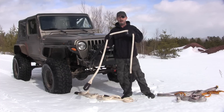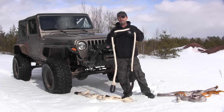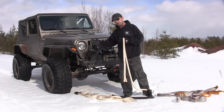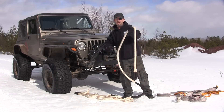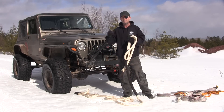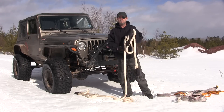This is a one-inch rope. It allows me to pull a full-size vehicle out of a ditch. Lots of stretch factor and that's the whole key to it — it's the kinetic energy that the rope stores when you pull on it. You give a good tug, your vehicle pulls, the rope stretches, and when the rope tries to go back to its original form, that's the kinetic energy stored in the rope that gives the slingshot effect to the vehicle you're recovering. That little slingshot is what gets them out.